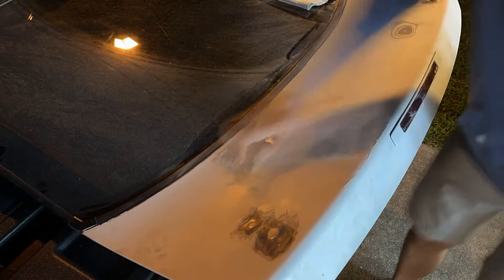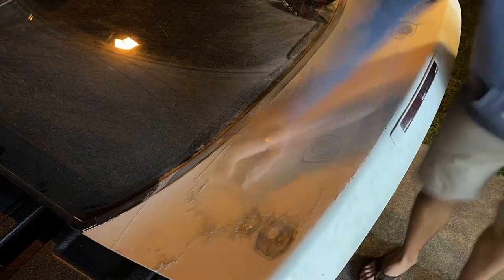I did achieve some pretty good results though, and I really found that the only way to get to where I was satisfied was just putting in the hours. I have the luxury of this being my second car, so I was in no rush to get it painted and installed, but I did spend almost two weeks going out and sanding a little bit smoother each day. This is what we were looking at after the first night of sanding. I really found that the method of shining the flashlight at a low angle worked really well at showing the high and low spots easily, and I used this method over and over again throughout the whole process.